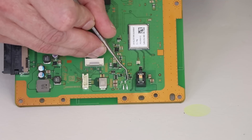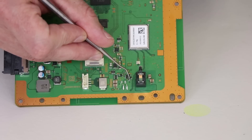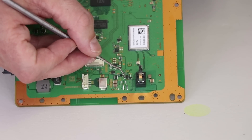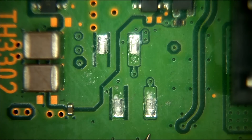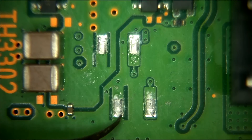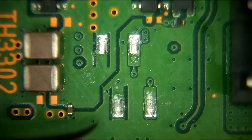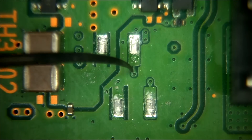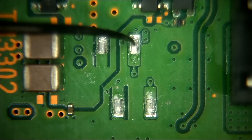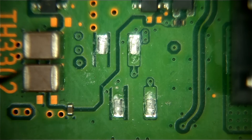For example, if this part right here tore off, you need to get a tiny wire and connect it right here, install the connector back on this area, and then bring the wire around and connect it to this pin on the connector. Now here's the close-up of the area where the connector was torn off. This pad goes into this circuit trace, this pad into this circuit trace, this pad is ground, and this pad is a power pad on this plane. These two are easy to fix; the other two are not as easy — if the whole pad is torn up you need to run a trace wire and solder it to the pin on the connector. Luckily this one just pulled off cleanly, so these are the easiest to fix.